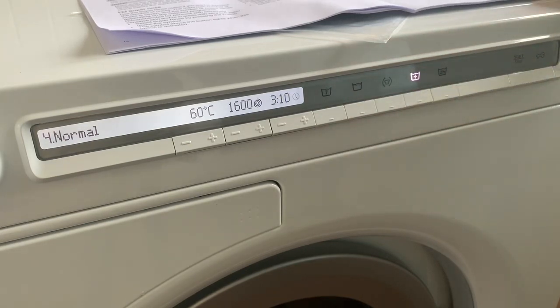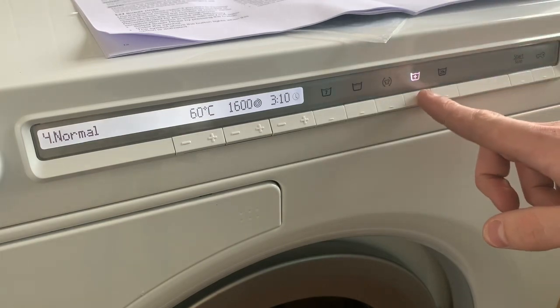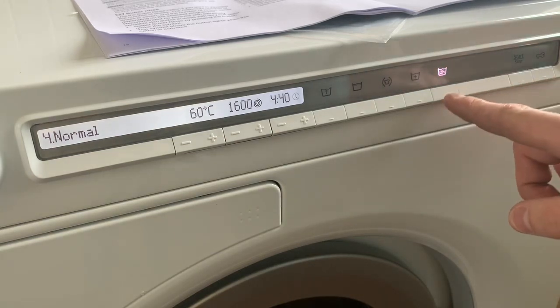Super wash. Super wash can be selected to better dissolve difficult stains and heavy soiling on clothing. This option adds a cold pre-wash and the wash time in cold water is extended by approximately 6 minutes. The main wash time is also extended. 2 hour pre-soak. If the washing is stained with blood, for example, we recommend a pre-soak. The washing will soak in cold water for 2 hours before the program starts.